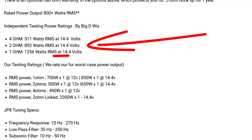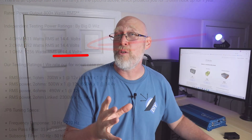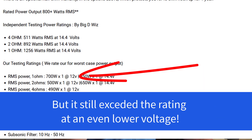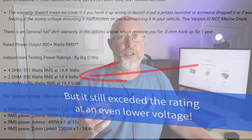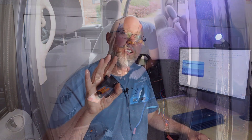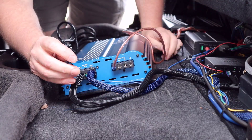When Derek Williston tested this amp he got over 1200 watts out of it — let me explain why we're getting a different result. I'm using a 100-amp power supply and the owner's manual says not to run it past about 80% capacity. I'm drawing more current than my power supply can handle, so the battery is now powering the amplifier, causing a big voltage drop. This is exactly what happens in your car when you try to draw too much current — so a test like this is a real good representation of what it's actually going to do if you don't have an upgraded alternator.